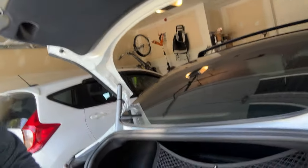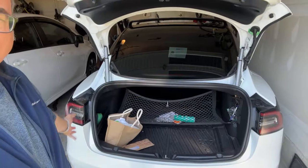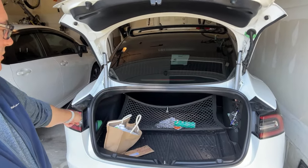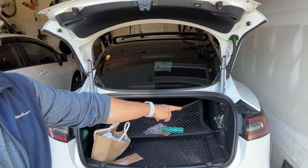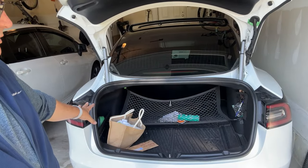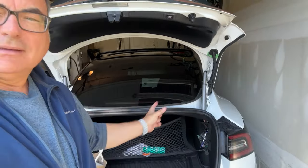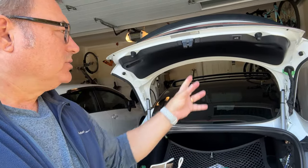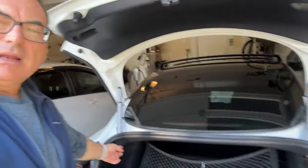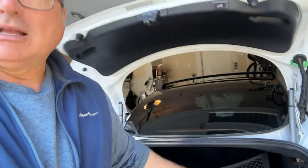So it looks good. And then one thing I did want to mention earlier, when I talked about running the cables here, is because I swapped it. So instead of the box being on the passenger side, it's on the driver's side. And instead of that outlet that has a single yellow cable being here, going here, because it's a longer run on that one, when I ran that up to here, I was just a tad short, like a couple of inches. It was putting a bit too much stress on that line. So what I did is I ran it up and underneath the top here, just like some of the hood stuff is. That gives me lots of slack on that line.